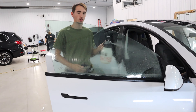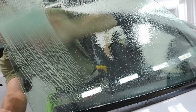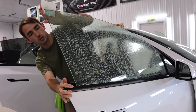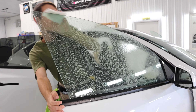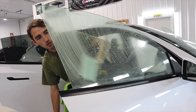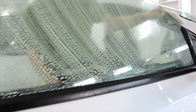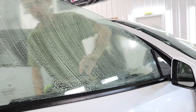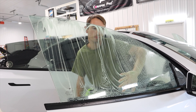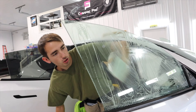On the inside, where the film is going to sit is where we really want to make sure the prep is adequate. So we're going to really scrub it. Make sure you get the top edge too — a lot of debris will sit up there and you can ruin your tint job very easily. After you give it a good scrub, use your hand and you can actually feel the debris if there's any debris or adhesive on it. I actually feel a little bit up here, so I might just go over it.